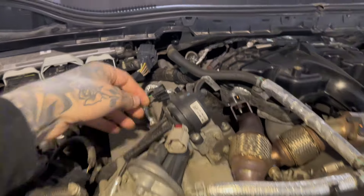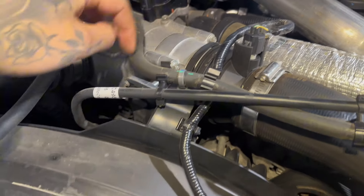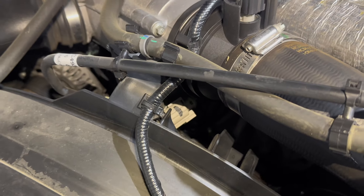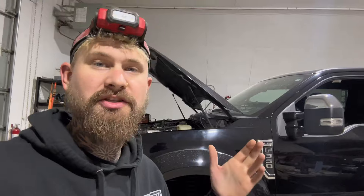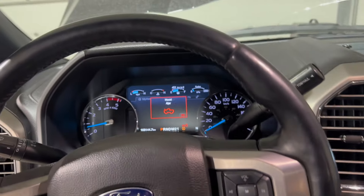Under the hood, unplug your EGR valve — there's also another plug right here, just unplug this from your EGR system. You're also going to have to unplug your throttle valve, which is right here — the plug is right down there. If you are deleting the truck you only have to remove the actual exhaust; you can leave the EGR on the engine if you're not doing the EGR delete. But you must unplug the EGR and that throttle valve. With those unplugged, start the truck, let it run for a minute, shut it off and do that two times, and make sure you get no engine lights — that way we know the tune works fine.